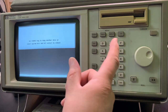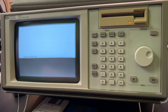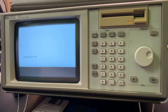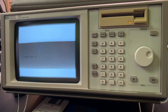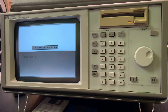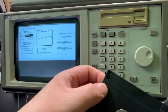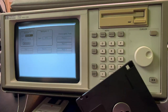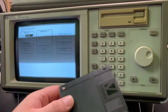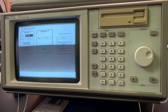So now, since we're actually copying the system disk, let's just let it move from this one. I'll take it and see if it loads. Seems to work okay. And all I'm going to do is enable the write protection on this one, because it doesn't seem to matter — it doesn't complain. So on these HD disks I'm going to enable write protection just to prevent this double-density drive from trying to write data to it.